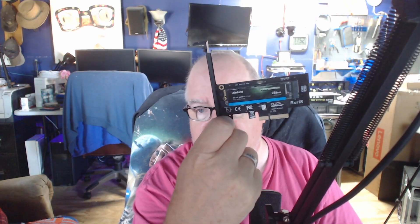There were two onboard NVMe slots. This is a Gigabyte B450 Aorus Pro Wi-Fi motherboard. On this motherboard, they have a really long slot next to the video card, and then they have a shorter NVMe slot next to, I think, PCI Express slot 2. And that is where I had installed the NVMe drive — partly because it was only an 80mm NVMe drive like this one, it's a short one, and that was a short slot. I didn't have a clear understanding of how those slots work, and it was running at a slower speed.